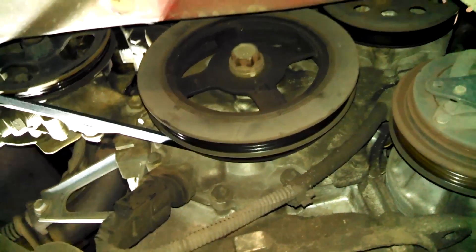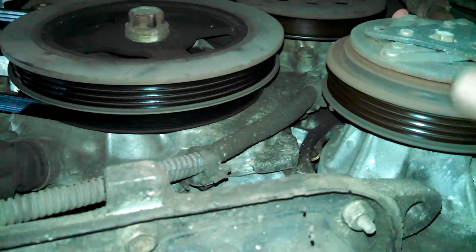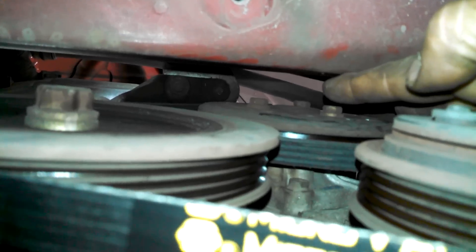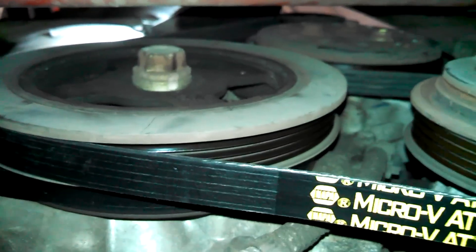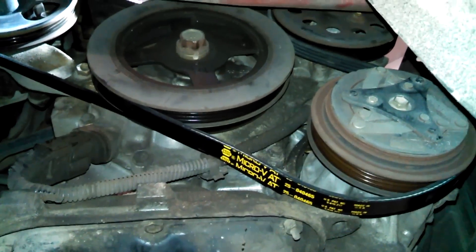We'll work on putting the water pump, AC, and alternator belt back on — you may or may not have AC. It's a good idea to draw a diagram of the routing of the belt, so yours might vary a little bit. Since I was already down here to do the power steering belt, I thought it might be easier to do it from down here. The belt comes around the alternator up there, then around the water pump here, and then down and around, back up around and straight up to the alternator, which is loose — plenty of free play here. I'll go up top and tighten up the bolt.